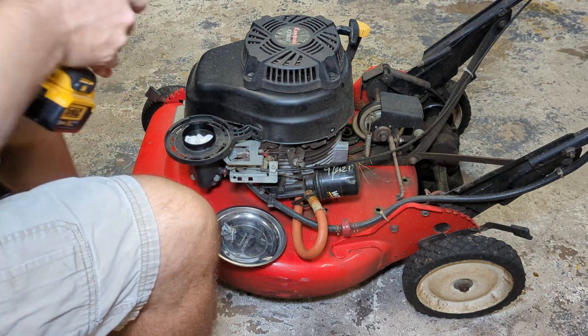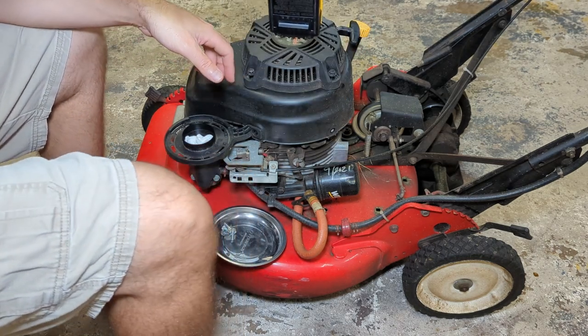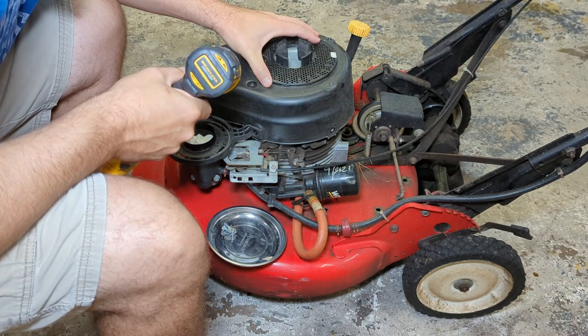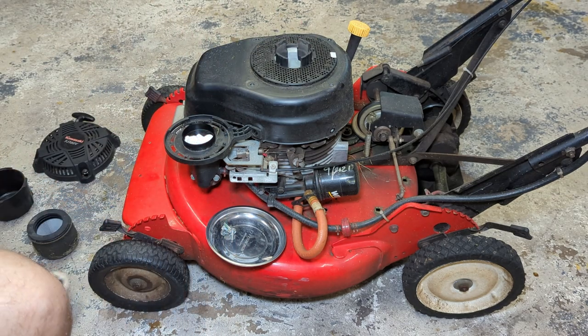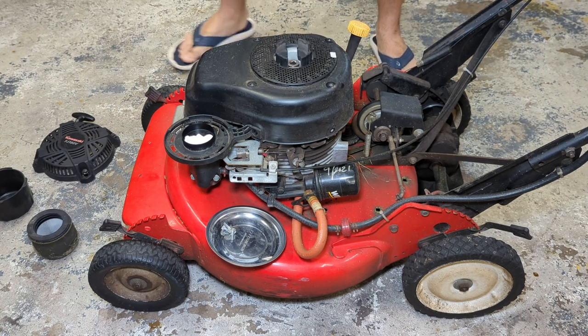Oh, maybe it's the screen under the starter. So, trying to remember what holds this on. I guess we have to take the flywheel nut off. It's kind of a weird design. I don't know how crazy I am about that. So it looks like maybe an 18 or so, maybe bigger than that. Actually a 17. 18's a little loose. Yeah, 17's much better.